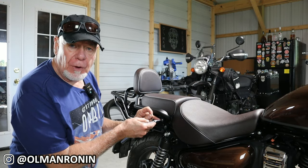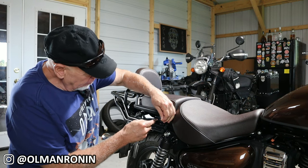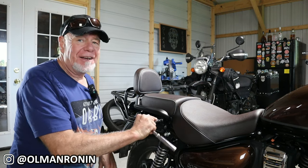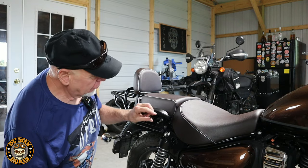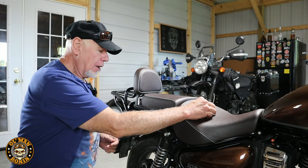Here's a tip: if the inside of the Allen is rounded — particularly on these button caps — find a small rubber band, stick it over the hole, and push it in. It'll come right out most of the time. If it won't come out, it's time to use a screw remover. I keep a lot of these little rubber bands around for that very reason.